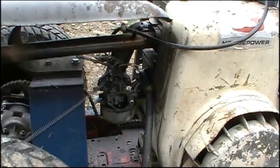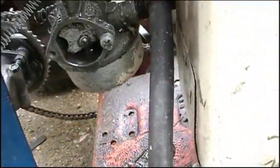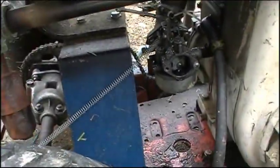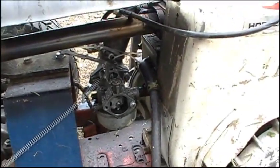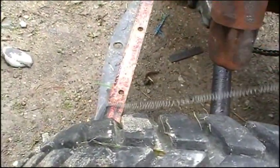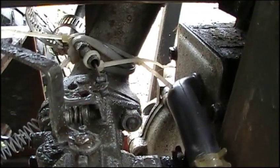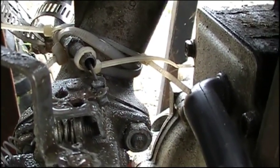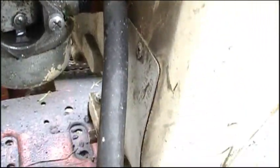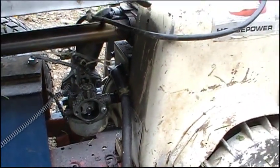On the other side, you can only see about half of it because the seat is still on, which by the way is only bolted down with one bolt on each side — it's also missing the front bolt on one side, so the whole seat just barely sits there. The exhaust is completely loose. The throttle cable is zip-tied to the intake manifold and just kind of stuck into the throttle. PCV is not hooked up, no air filter — I had a little piece of cloth on there but it fell off after about 10 minutes of riding.